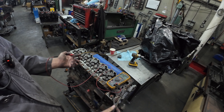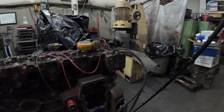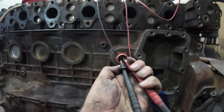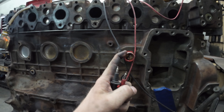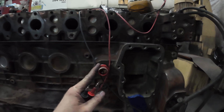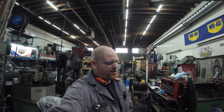The easiest thing to do is unplug the block heater from the cord and go down to the block heater connection. Touch those two poles on the block heater directly. If the block heater doesn't give you anything there, it's the block heater that's no good. Most of the time when you buy a new block heater it comes with a new cord — I would replace both — but you don't have to, because sometimes they're snaked into vehicles and aren't fun to get out.